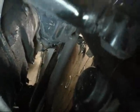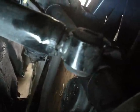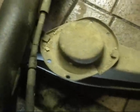I might stick the tail shaft on tonight. I'll have to put the other mount on over there, and I'll do the springs and the brakes tomorrow. This thing should be nice to drive. All the lower control mounts on the old diff are screwed — these ones are nice and tight, the other ones just flop around. She used to buck a little bit when you hit a bump with the rear axle, and that's probably half the reason why.